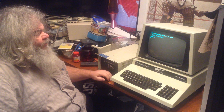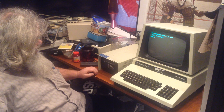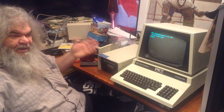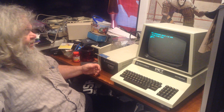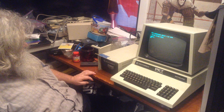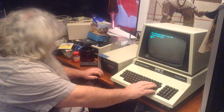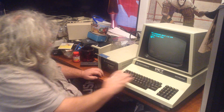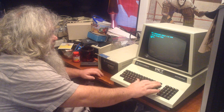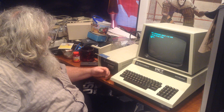So what I'm going to do right now — the pad is up, I'm going to turn on the hard drive and just see. Because I remember yesterday it was fine, and then something wasn't fine, and maybe it was heat-related. I'm going to turn this on, turn the pad off. I can see where our message is. I'm going to let it spin up and hit it with a catalog command. And, just like yesterday, it freezes up tight.